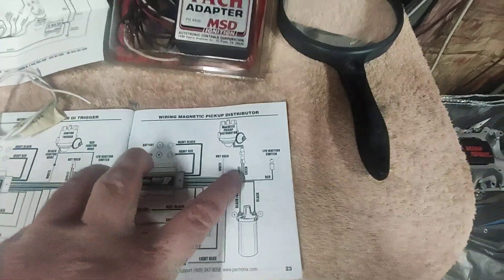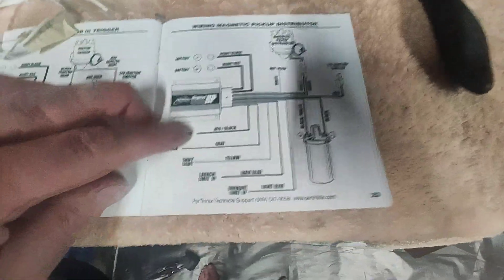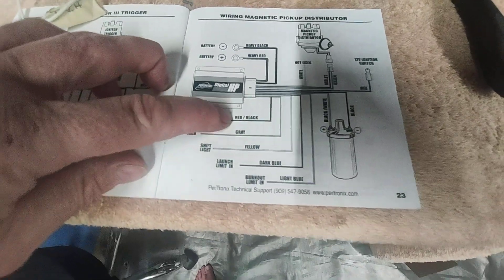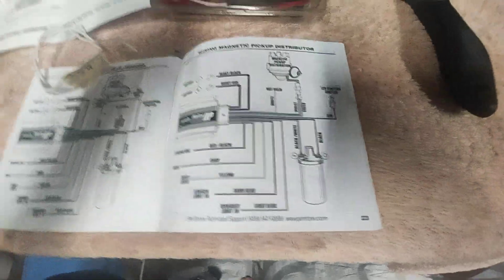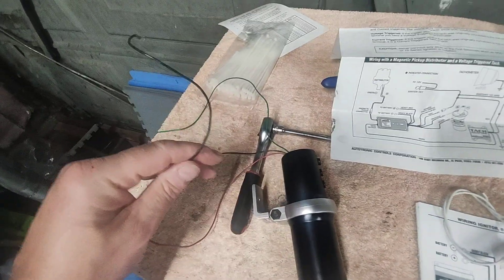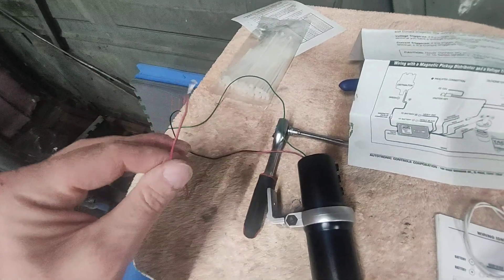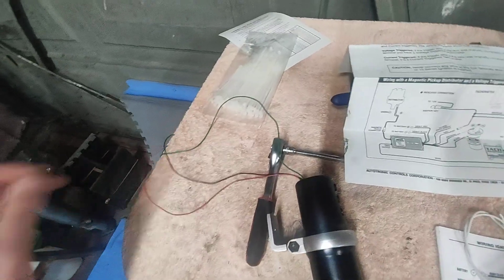This is how we're wiring the magnetic pickup for the DuraSpark. We're using this plug here — don't use the white wire. There's a gray tach wire and then a special red and black. The red and black goes to the positive side of the coil, so it's a switched 12-volt. The tach wire goes to the green, black is ground, and this goes to a switched 12-volt on the fuse panel — on the radio circuit or something.